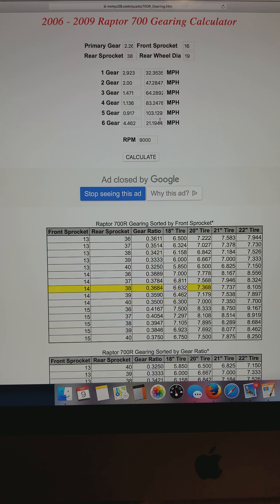On the hill we're running about 15/40 to 15/43, running an 81-82 rollout, so we'll go to a 25-inch tire — that's a short end. On an EFI bike that's normally turning 9,000 RPM, calculate that out at about 90 miles an hour out on the sand. You do get some slip there, so there are some losses. This would be at the rev limiter at 9,000 RPM.